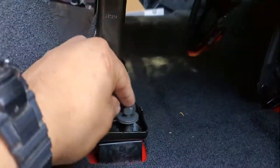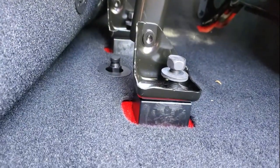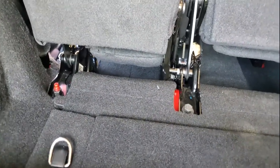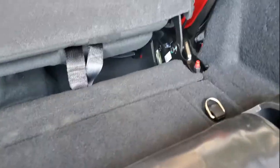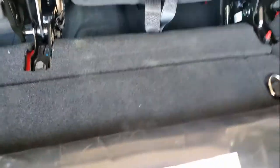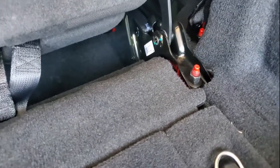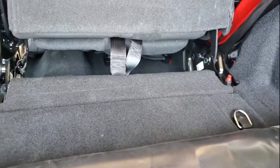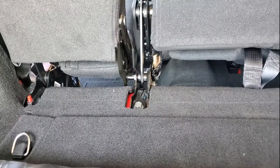The spacer is installed and the longer bolt is on as well. Here's a close-up look at how it's going to look. We're pretty much done with the installation. The last items to do are torquing down the rear bolts — the instructions indicate to torque them down to specifications. The two nuts on the corners, where the thread is sticking out, torque those down to 62.5 foot-pounds. The center one gets torqued to 45 foot-pounds. Make sure to torque these down — it's important for your safety.